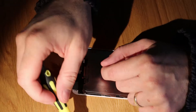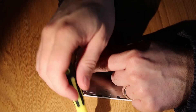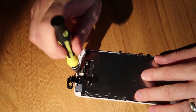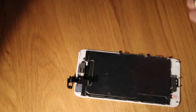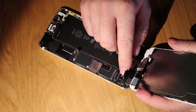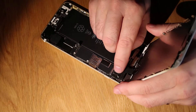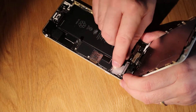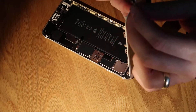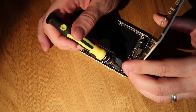This is one of the easier jobs when repairing an iPhone, however it is a little bit fiddly. As long as you keep the screws in the same order as you took them out, you'll be absolutely fine. Once we've done this we just need to pop it back into the iPhone body — I've sped this up so you don't have to watch it all. We reconnect the screen by popping the connectors back down one at a time, then pop the metal bracket back in place and screw it down with the four screws. After that, pop the battery back down and put the two screws back in holding that metal cover in place.